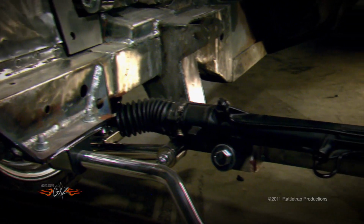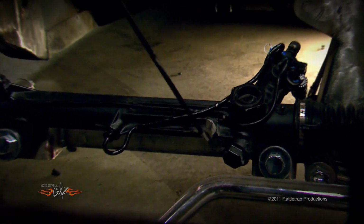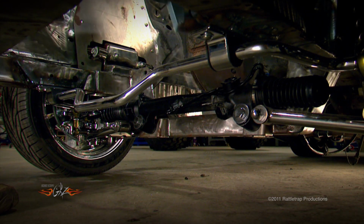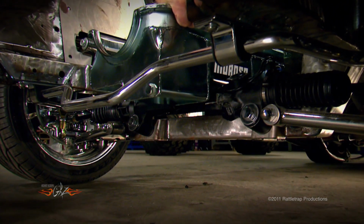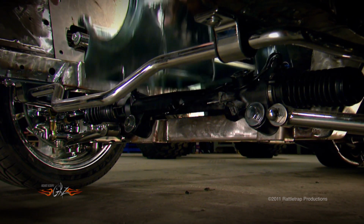The steering rack needed only slight modification for oil pan clearance. This tab here needed to be ground down a bit. The oil pan you need to use is from Moroso, and it's designed to fit a Ford 460 engine into a Fox-bodied Mustang. Due to its unique sump design, it fits right around the steering rack and crossmember with just a few inches to spare.